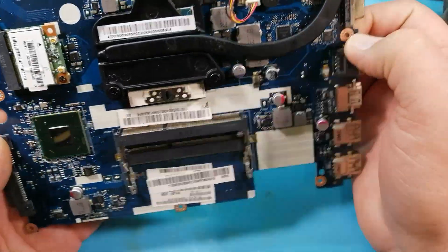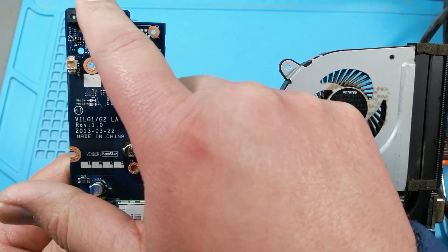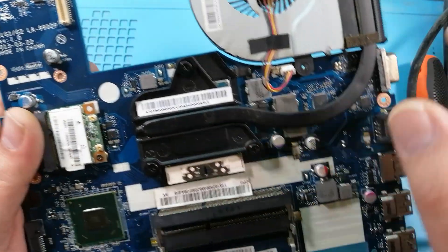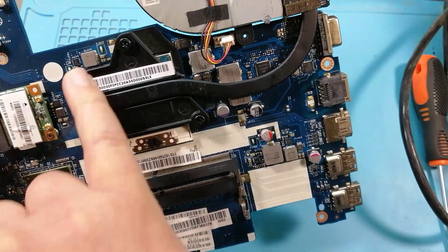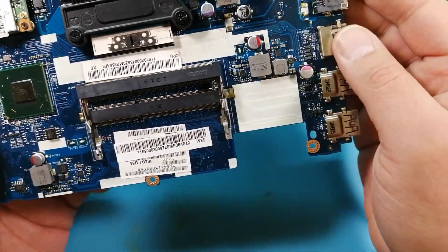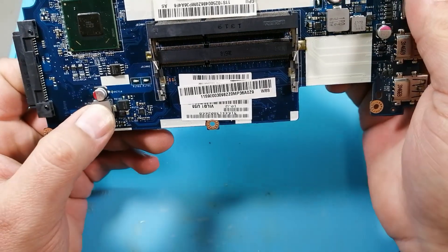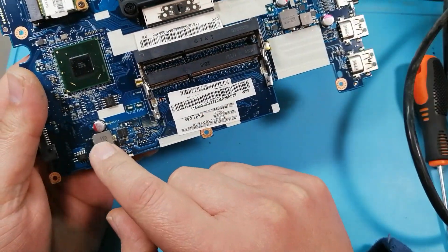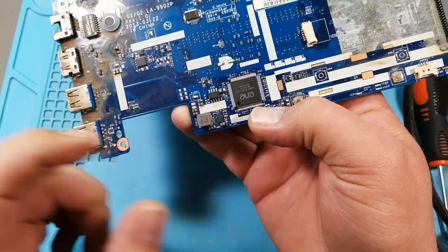Let's have a look at the coils. Power comes in here, you've got your first two MOSFETs — so this will be the charging for the battery. This capacitor is rated for 25 volts, so this will be one of the main rails. We've got CPU, CPU, CPU, CPU — so these are all CPU-based coils. Then we have two next to each other: one should be 3.3V, one should be 5V. And this one is probably PCH power, which is a 1.05 volt rail, and this one is probably the RAM power rail.